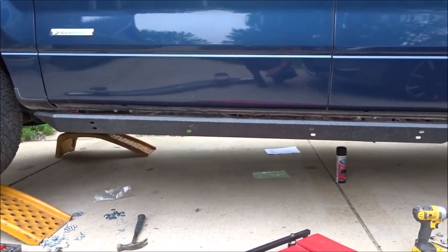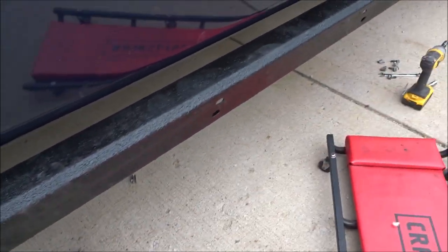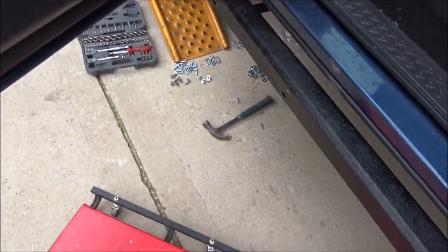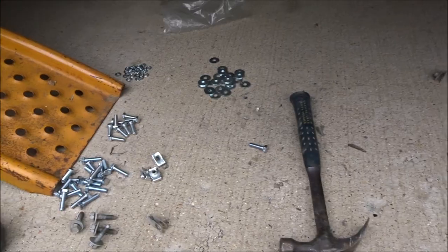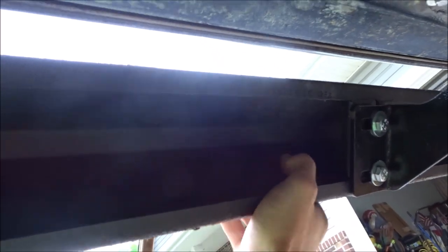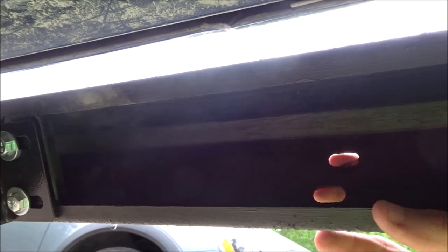It's sticking out a little further than I was hoping, but it actually looks a lot better than what used to be there. We just have to install the steps now and it's good to go. I did have to reuse the old clips — I put them on the bracket itself so the bolt goes into the bracket, because otherwise you won't have enough nuts. These four here are for the other side, since you need the nuts to bolt the main piece to the bracket. I'll put the steps on; they come with separate bolts and screws.